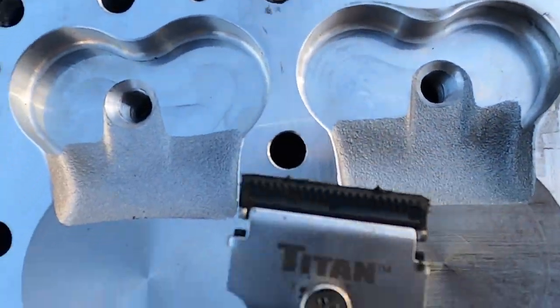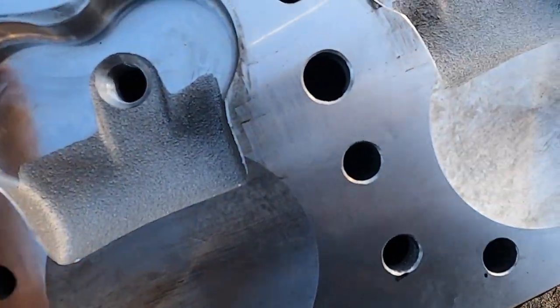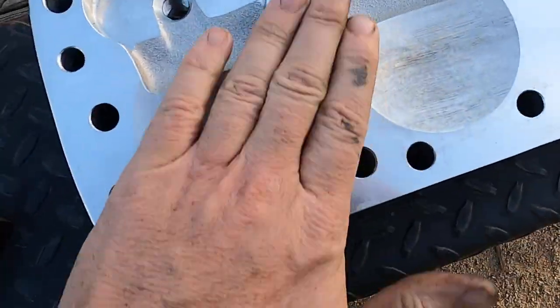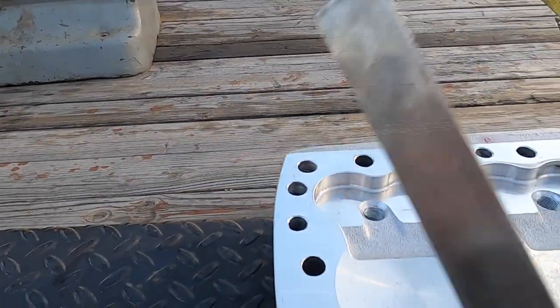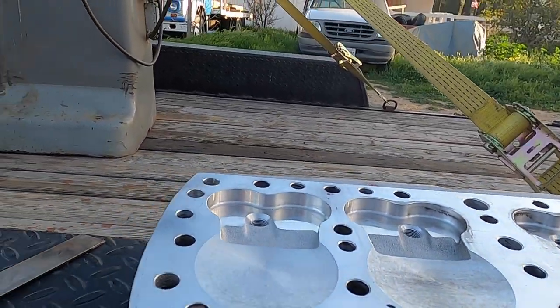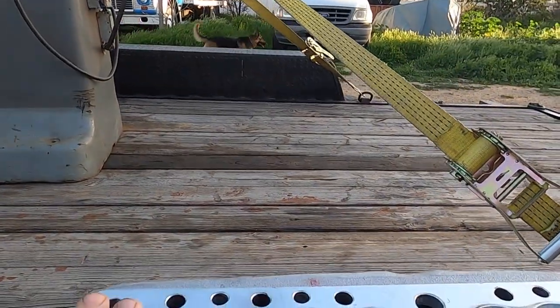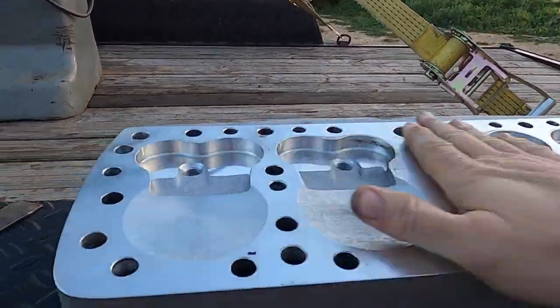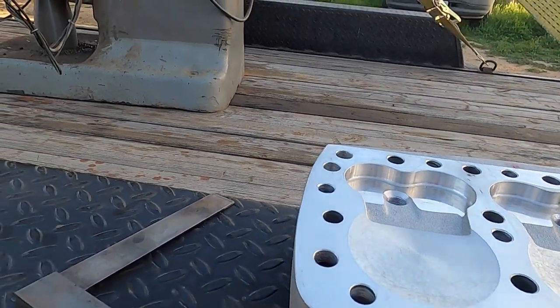Using a plastic tip on my gasket scraper. Got that down and good. Now, with these aluminum heads, it is generally considered good practice to have them decked right out of the box. Don't even worry about it, just deck them before you put them on.